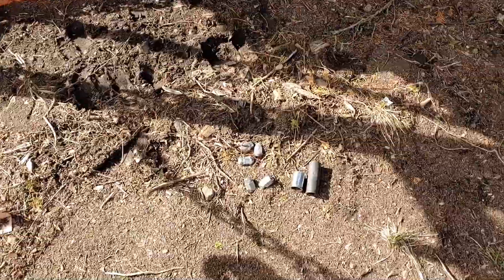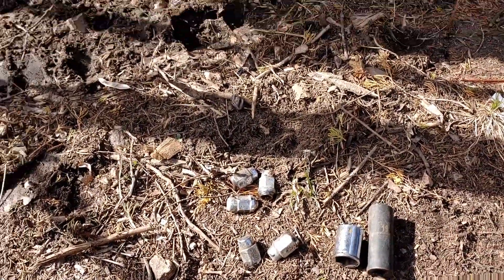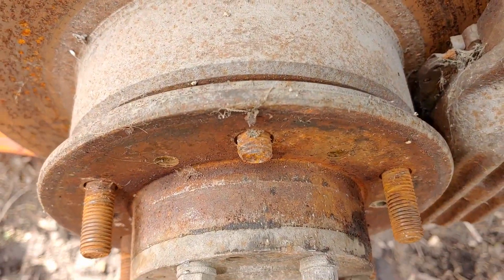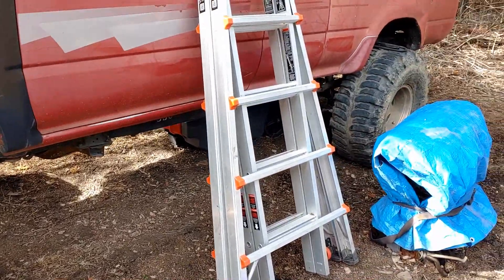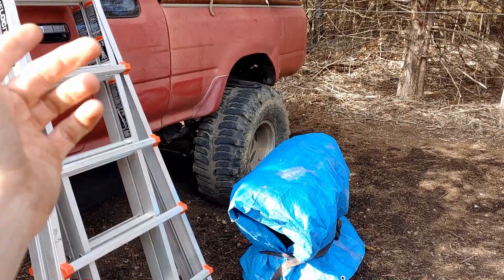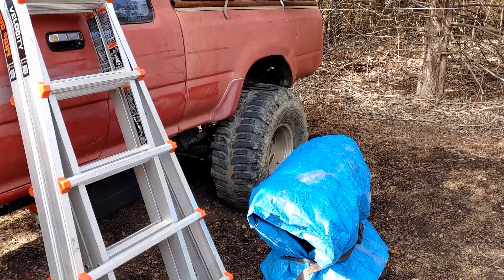You may be asking yourself why I only removed five lug nuts off of a six-lug wheel. I'll leave you to draw your own conclusions. This truck has been notorious for snapping wheel studs, especially in the rear axle. I probably put 30 lug studs in the back of that axle alone and it only holds 12.